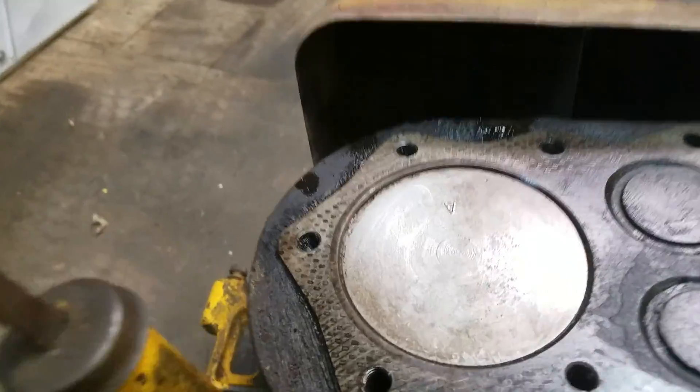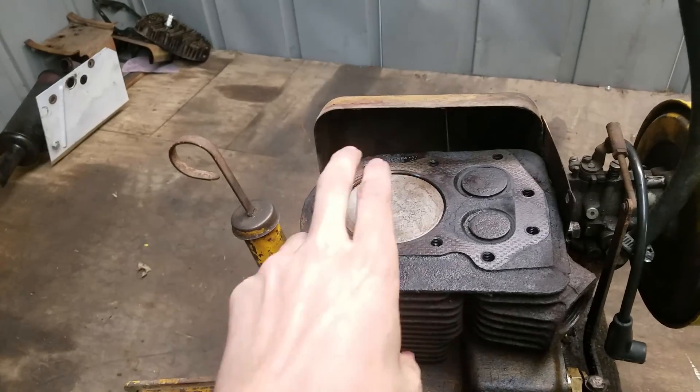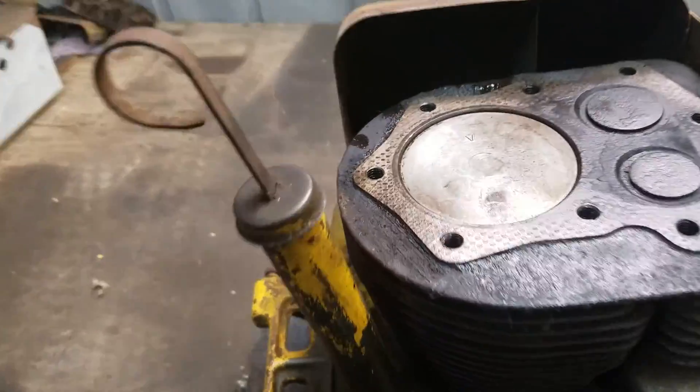Tell me down in the comments — Mike, Nick, if you watch this video — anybody that's good with Cub Cadets, what does the A stand for? Does that mean it's a standard piston? Because it feels bored over. It'll have a .030 for thirty thousands or .010 for ten thousands. Hopefully the kit I get online is 30-thou over, so I'd have to bore this motor out.